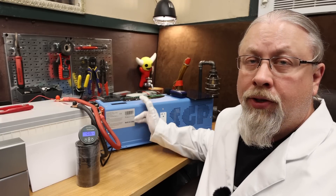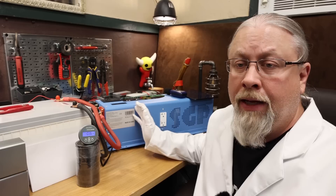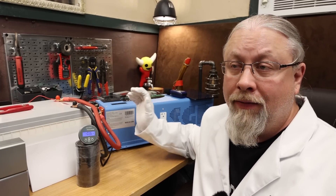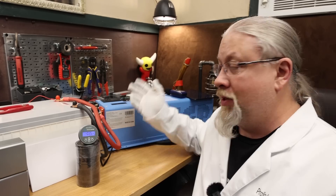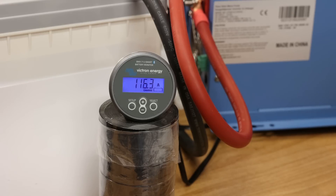Next is the charger test. This has a 120-amp maximum charger. When the battery is completely dead it will put out 120 amps; if it's more than half full, it gives less. The battery I'm using is discharged to about 70%, so we should still get around 115 amps — and I've seen this push 119 before. For the camera, we're seeing 115–116 amps when the fans kick on. I call that a success.